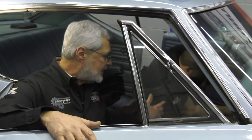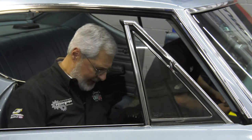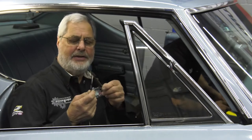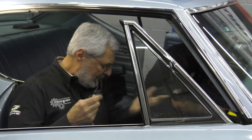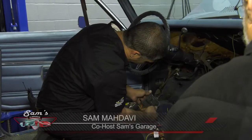The first project we've got is this 1968 Malibu. When you're going to restore a car, fix it up, spend money on a driveline, paint it, do an interior — before you get that far, do like Sam has done for his customer here: fix the wiring harness. It's 50 years old, it wasn't great when it was put in at the factory, and we found all kinds of things like splices that didn't even have the twisted wires together — no tape on it. The bulb sockets are no good. You don't want to ride down a road and have 50% of the stuff work only when it wants to.